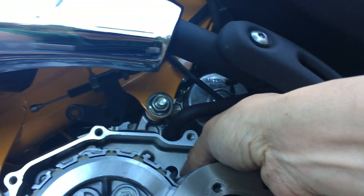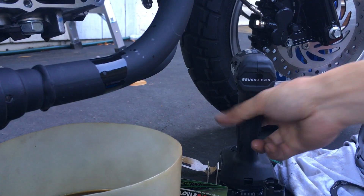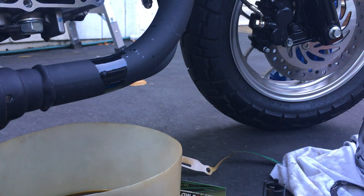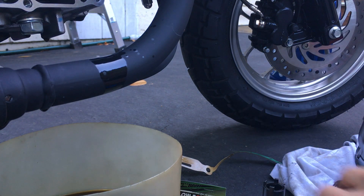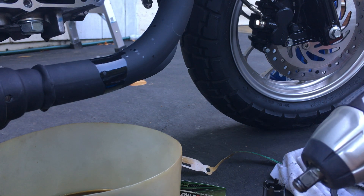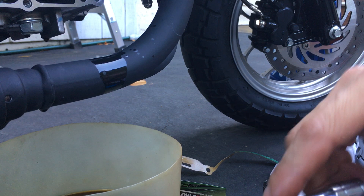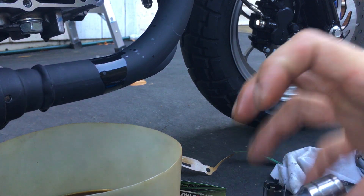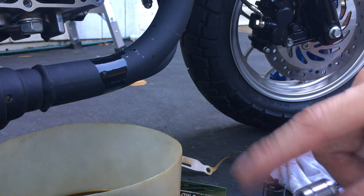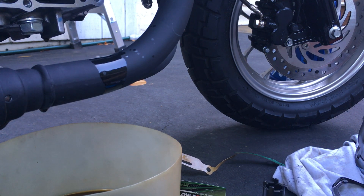Since I have an impact driver, I'm probably going to try my impact driver — actually no, I might not, because I don't have an impact extension. My impact driver is not going to reach far enough, and I don't have an impact extension. I have a regular extension, but I don't want to use it because the impact extension is different — it's more hardened, made to take the impact. If you use a regular extension you could damage it, wear it out faster. So I'm actually not going to use the impact driver at all.